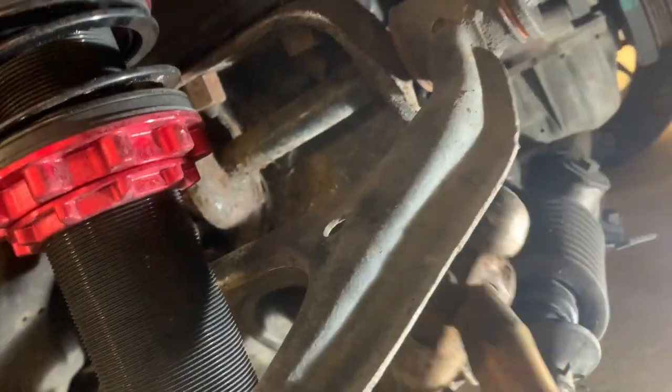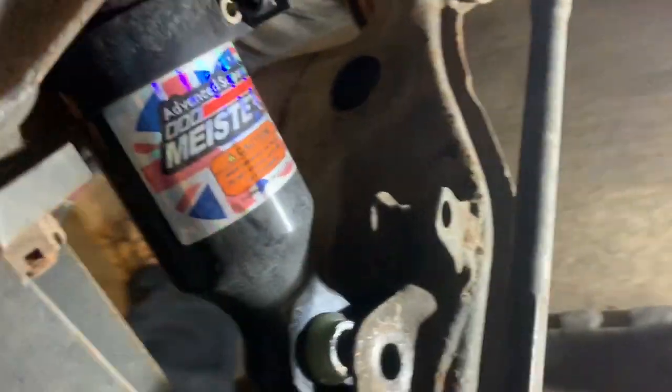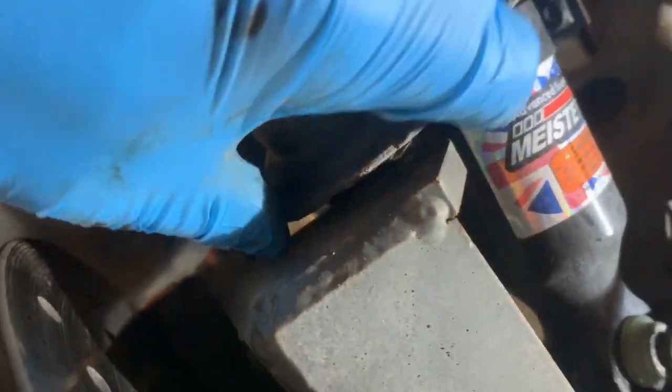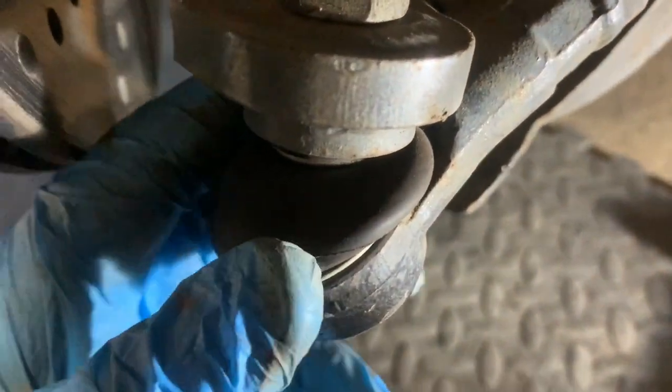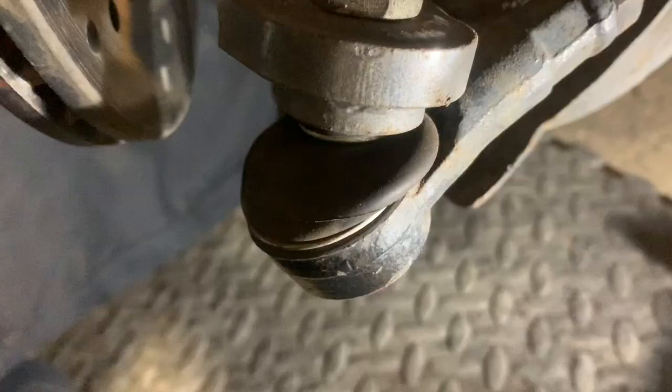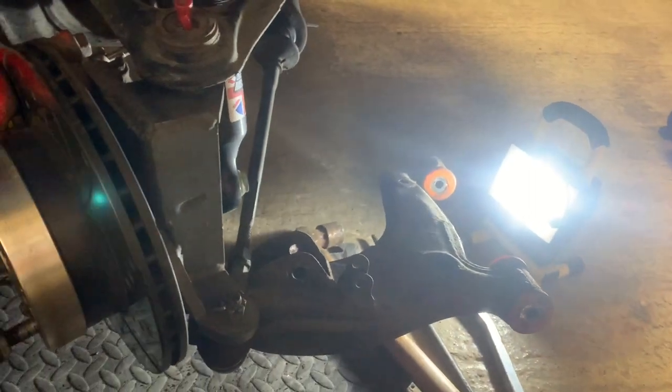Don't forget this one just in here. Once the back's off, give it a bit of a knockout — work it at an angle so you don't have to mess around with any ball joints and dust covers, especially if you're road legal, as cutting these is an MOT failure. These are brand new. Push this down at the back and it'll allow you to get to the other ball joint once it's dropped out. It'll still be connected here so you can freely swing the wishbone out.